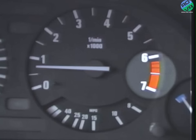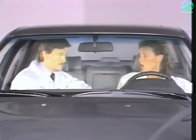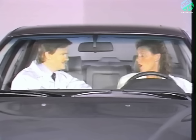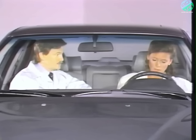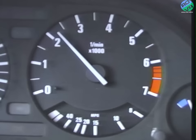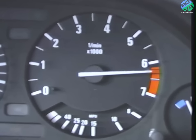Why is there a red section in the tachometer? That's to tell you that your engine speed is too high — you avoid that. Excessive engine speed can cause real damage. It's engine speed, Mrs. Kelly — it can happen when you downshift or when you're driving downhill. There's a fuel injection control unit that has a fuel cutoff circuit that limits maximum engine speed when you're accelerating. It kicks in when the needle hits the red warning zone.